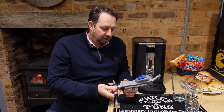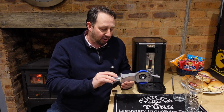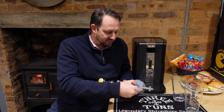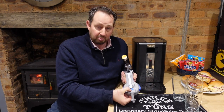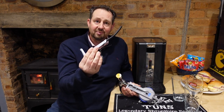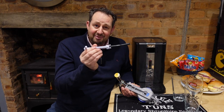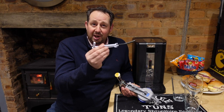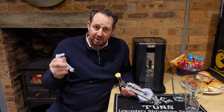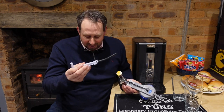You don't have to clean the lines on these. I was always worried about cleaning lines — I used to run pubs and cleaning lines was one of the biggest things we did. With this machine, you get a fresh line every single time. To remove the old line, clip down this blue button, it lifts up and we pull this — and hey presto, out it comes. These normally go in the bin, but it's always handy to keep one spare in case one gets lost in transport with a barrel.